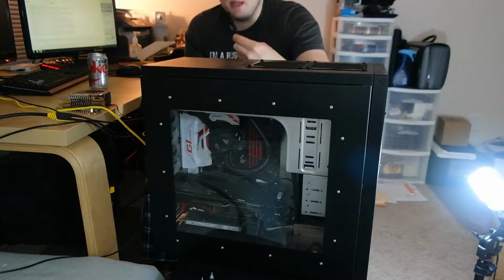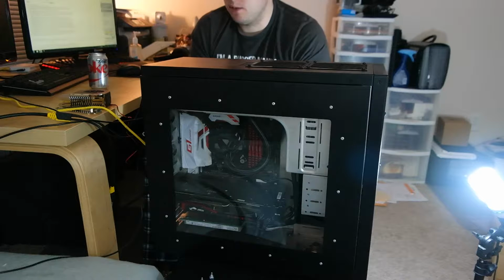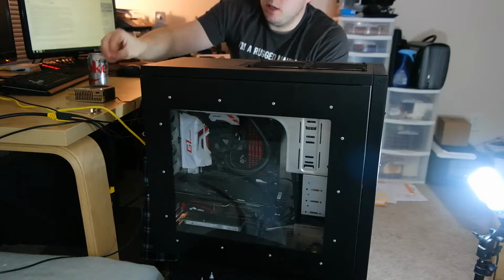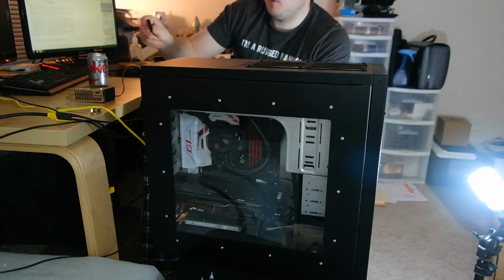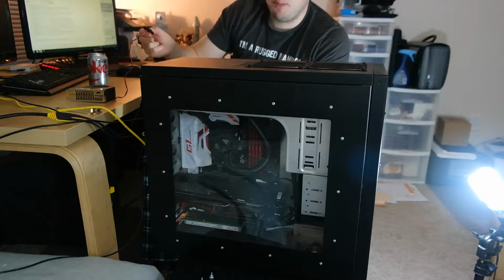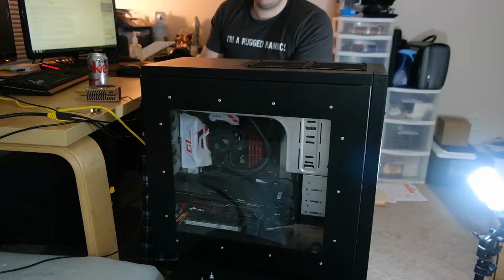So this was powering SATA drives, and it was powering certain light strips, but it wasn't powering others. And I eventually figured out with the multimeter that it's not the 12-volt that's bad, but the ground next to it. So I'm going to finagle this to make it work. I'm going to plug this in, turn it on, but I'm going to be essentially shorting one of the grounds to the other ground using a paper clip. And this is possible because the Molex connector for the Vantech fan that I'm using has a pass-through. So I can connect power to the fan and then short the grounds on the opposite side of the pass-through. That's what I'm going to do.